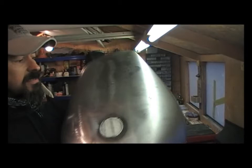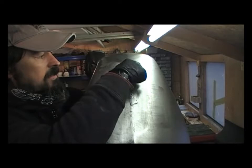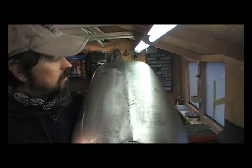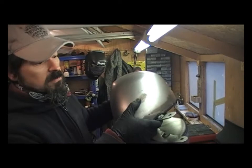So basically that's the tank. Down the centre — I've put a straight line across it right down the middle — from about there to there is where it needs lead, that area I'll float some lead in. There's no dents in it, it's quite a good tank. A few surface scratches but we'll take care of them.